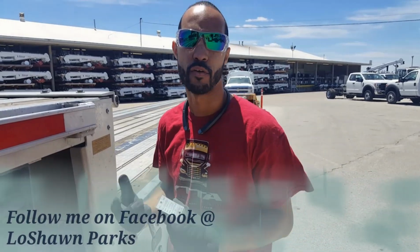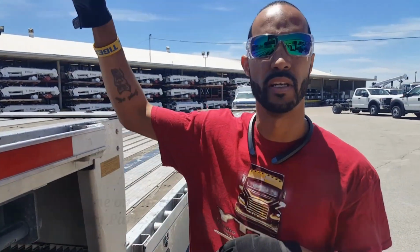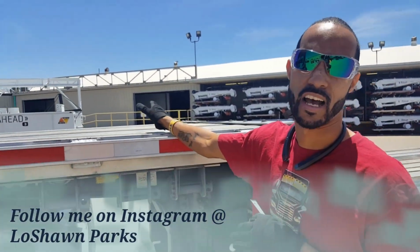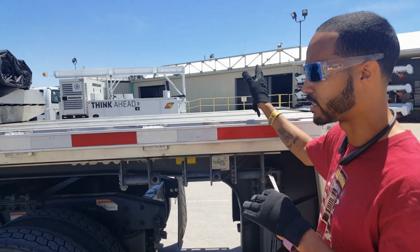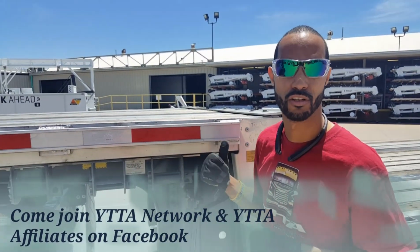We're going to do a securement video, how to load up a C3500 AT&T truck. What I'm going to be doing in this video is putting it on the top deck right here. This is the space that we're going to be utilizing. It weighs 8,000 pounds, and it takes up about 18 feet of the trailer. We need to still utilize the bottom trailer for another load we got.